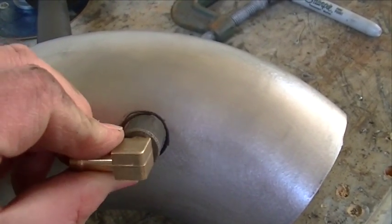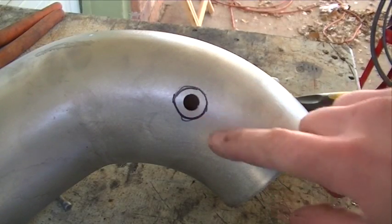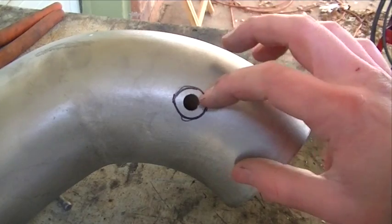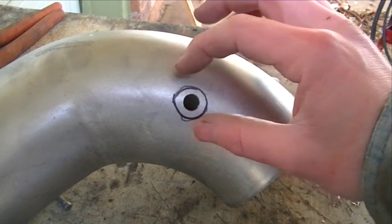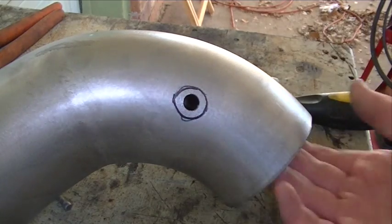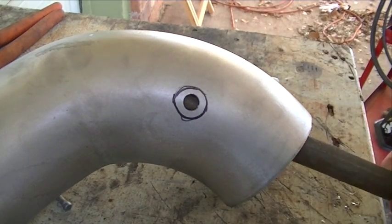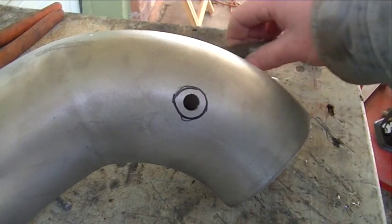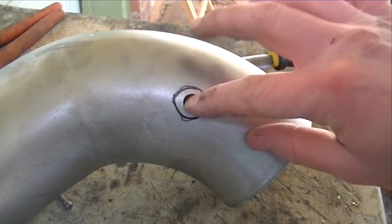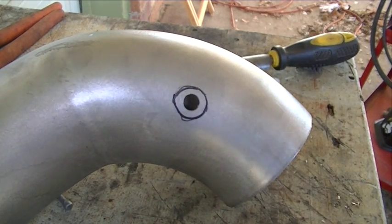There are really several reasons why I put this PCV port so close to the throttle body and underneath. Like I mentioned, it's discreet — you don't see it, it's out of the way. Second, it's close enough to the end of the tube that I can reach in there with a file and file out all those little burrs and shavings from drilling this hole. The last thing you want getting sucked into your engine is small little metal shavings.